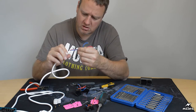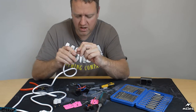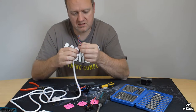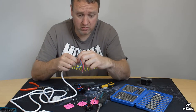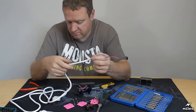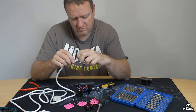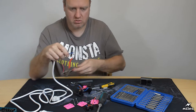And the cable, it's round in form, which is usually what you see on a three wire cable, or three core cable. This is two. I think it's been cast that way deliberately. They're odd colours, red and blue. It should be brown and blue. So yeah, that's another failure, but you know, it's failed in so many other ways that are more catastrophic that I'm not gonna lose sleep over that. It does feel very thin for what it says is good for 10 amps, is a little bit weedy. Let's strip some of the core off and have a bit of a look.